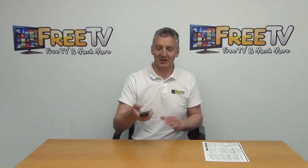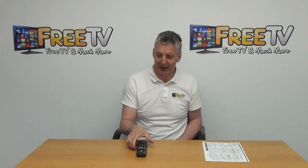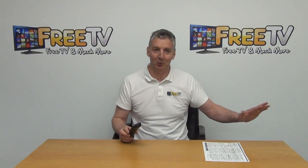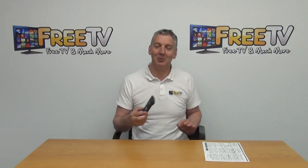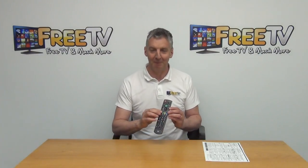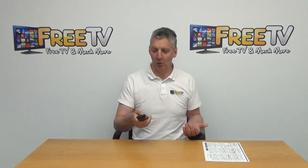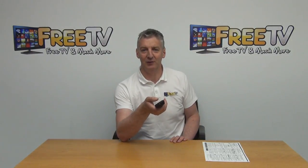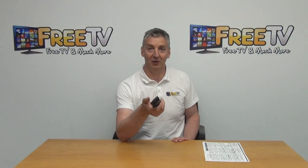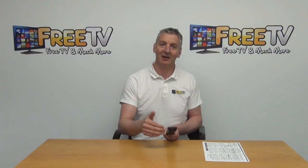You can then test all the buttons and they should work perfectly. But if you find one or two functions — for instance, the menu button — won't work, here's what you do: press the red and blue buttons again until the light flashes, then press and hold the menu button. After maybe 10 to 15 seconds, the menu will come up on screen. At that point, lift your finger off the menu button. The remote recognises that was the correct code and saves it to memory.